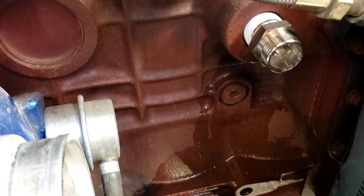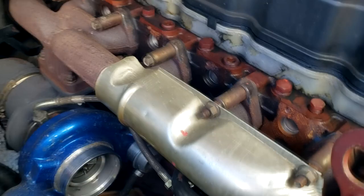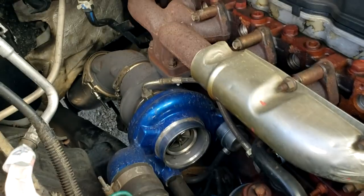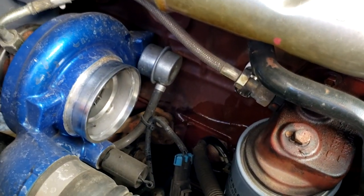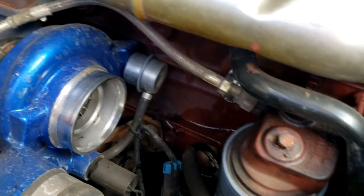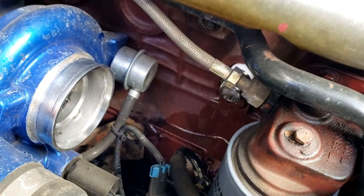All right guys, that wasn't too bad. So I have the heater element installed. I just have to tighten it up. And we were able to remove the plug very easily and did not lose hardly any fluid. Very minimal. I'd say I lost probably maybe 4 or 5 ounces of fluid. Pulled the plug off and then jammed that element in there as quick as I could. So we won't have to add very much coolant back, hardly at all.